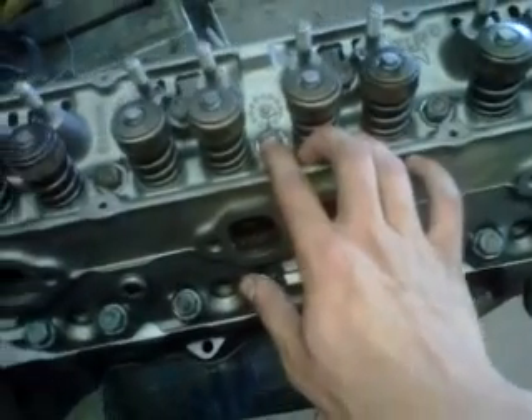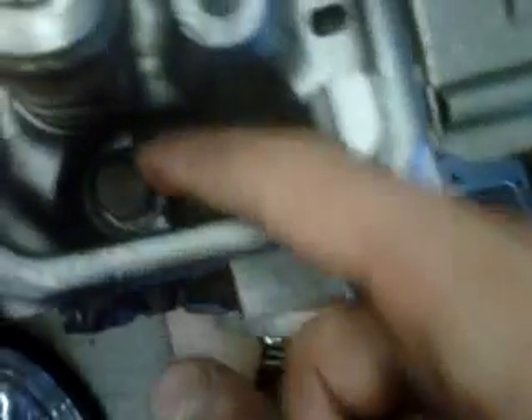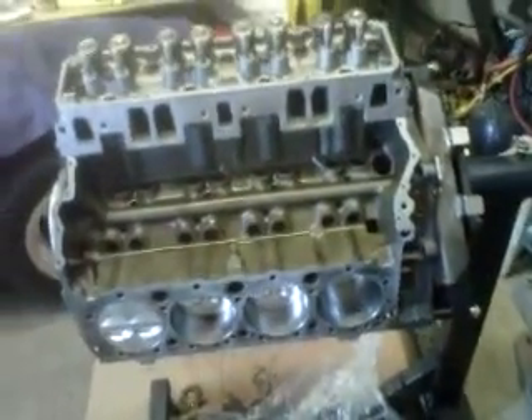What I found to be really important is making sure you lube up your threads — motor oil, assembly lube, really anything that can keep your threads nice and lubricated so you get an accurate torque spec. That's pretty imperative. Also put a little lubricant up on the head of the bolt so when it meets the surface there's some lubrication there as well. You want to eliminate all the drag that you can so you can be sure you get an accurate torque spec.